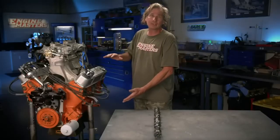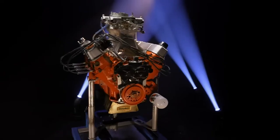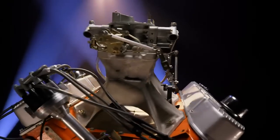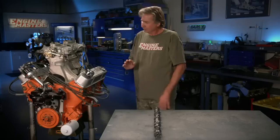and honestly, it hasn't been apart since then. Let me give you a little detail about the whole combination here. Most of the stuff is really stock passenger car equipment. I've got a stock 1969 block, a stock forged steel crank, and '67 440 heads, which I ported. Now the block is filled with some high-performance parts to add durability and performance.